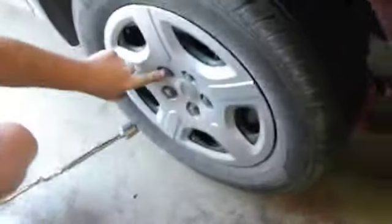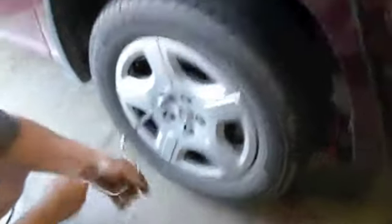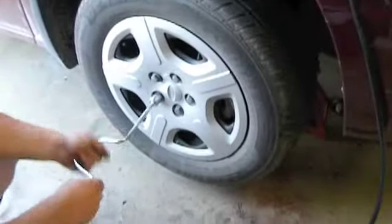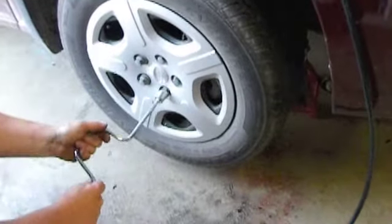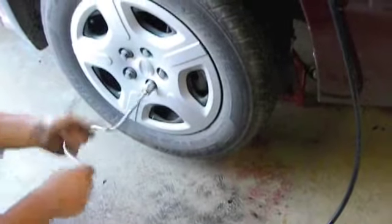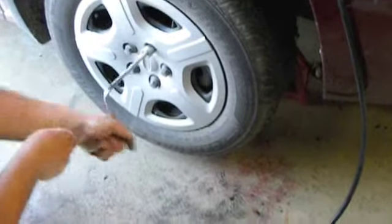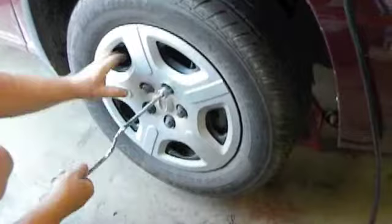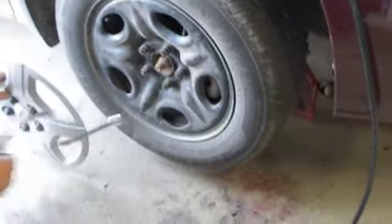If you look here, on the sides of the wheels, we have these wheel covers. These are not your lug nuts — these hold on your wheel covers. Take these off first. They will come all the way out; they are kind of locked in place. Take those out first. And lo and behold, there's your nuts behind.